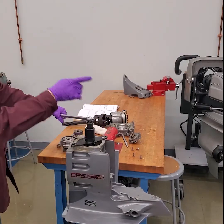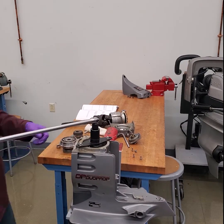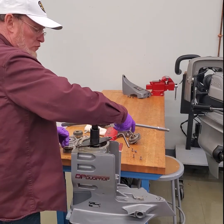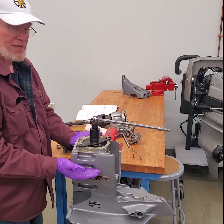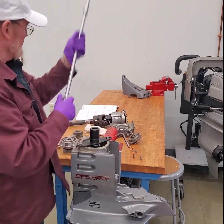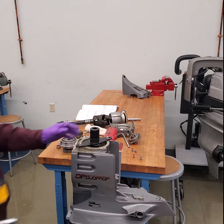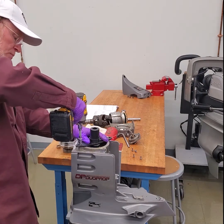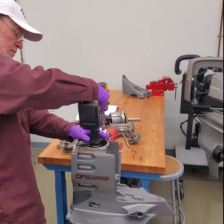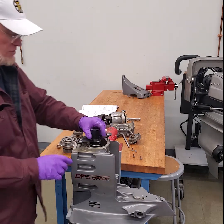I'm going to go counterclockwise. This is standard aluminum and that's pretty tight — as you can see, very tight. Turn it one full turn. Don't go any further because it's got fine threads in the housing and you don't want to strip them out if you keep going. I want to take this retainer off. I'm holding down on it — I don't want to strip the threads out or let them pull out of the housing.